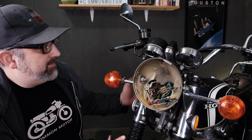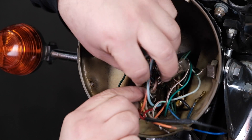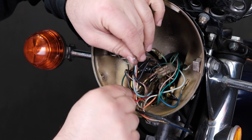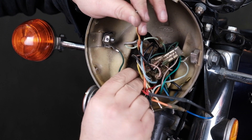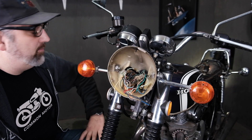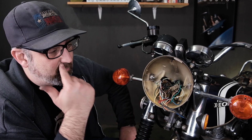Right now we want to test the start button circuit itself, independent from the rest of the wire going down to the solenoid. That is this yellow wire with a red stripe right here. Let's unplug it so you can see it better. We have one half of the circuit on the handlebar switch side, and another part on the pigtail going back through the harness to the starter solenoid, which is connected to 12-volt positive in this architecture. So let's identify which is which by finding which one has 12-volt positive power going to it.